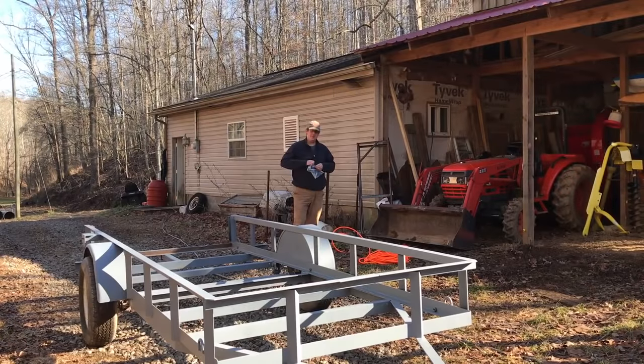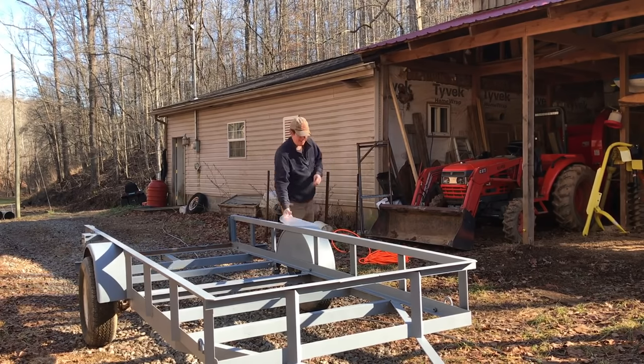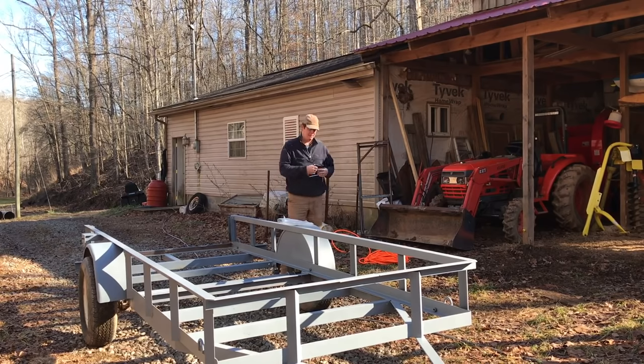For those of you that didn't see our primer video, I'll link to it here, but we talked about the finish coat we were going to do. We shot an etching primer, just a typical automotive etching primer. I think I got it at Rural King. But I got from LinerXtreme, a company that we're dealing with here, a 3-gallon kit, and it is a polyurethane-based bed liner kit that's tintable. We got it tinted red, so we can have it match Red Tool House.